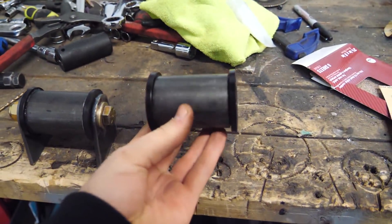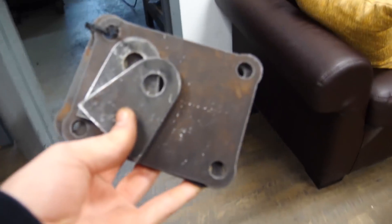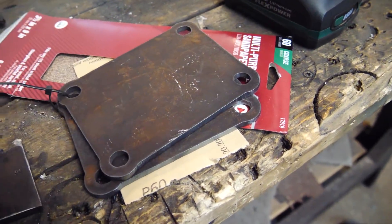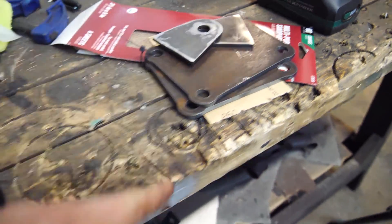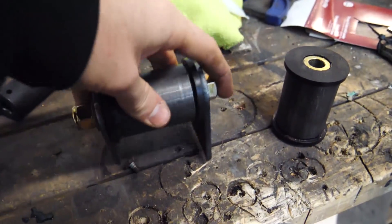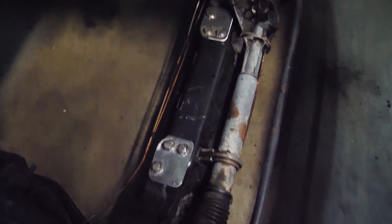So these are the finished bushing assemblies. Just like the solid axle, I had my friend Dan cut me out some plates for the motor mounts. This plate gets bolted to the motor, then you weld two of these uprights, and those uprights bolt through the bushing. Then the bushing gets welded to the things we made on the subframe.